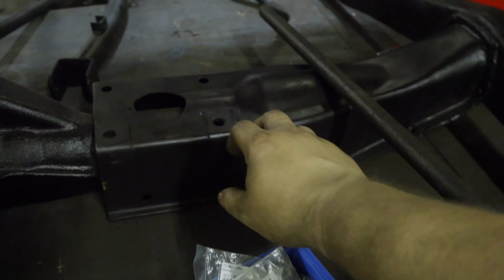I just wish the table were a little bit clearer, a little bit more empty. I put on the diff brace. It's not bolted on. It's just lower brackets are back mounted, so this can't slip apart because of the head of the drive shaft assembly, the pinion. The missing brackets are still drying, painting. I've got the control arms now finally torqued down and everything. I've got at least one side on which I have the axle nut.